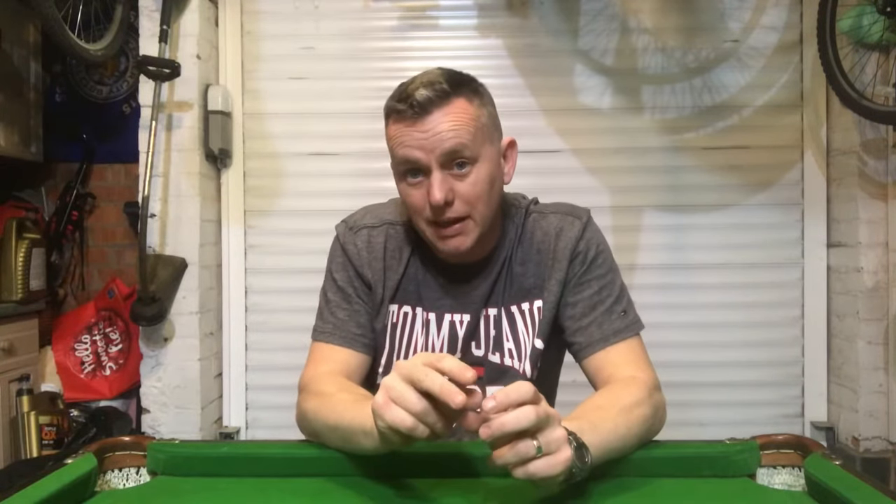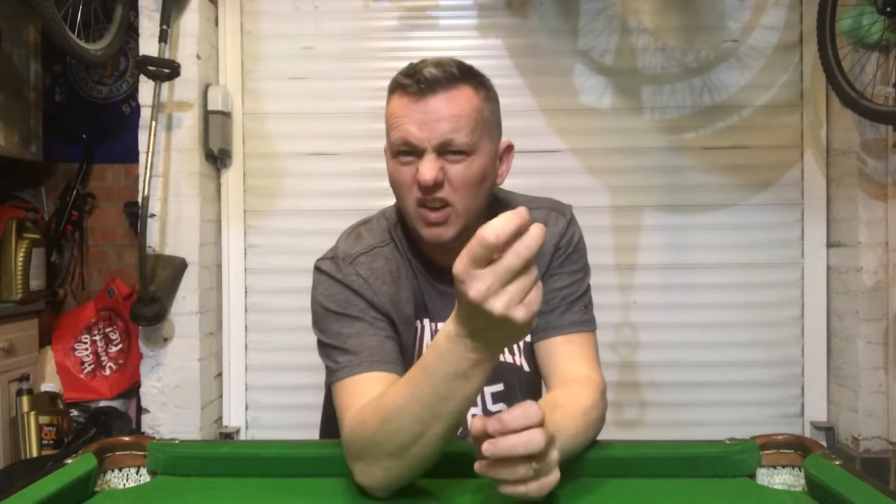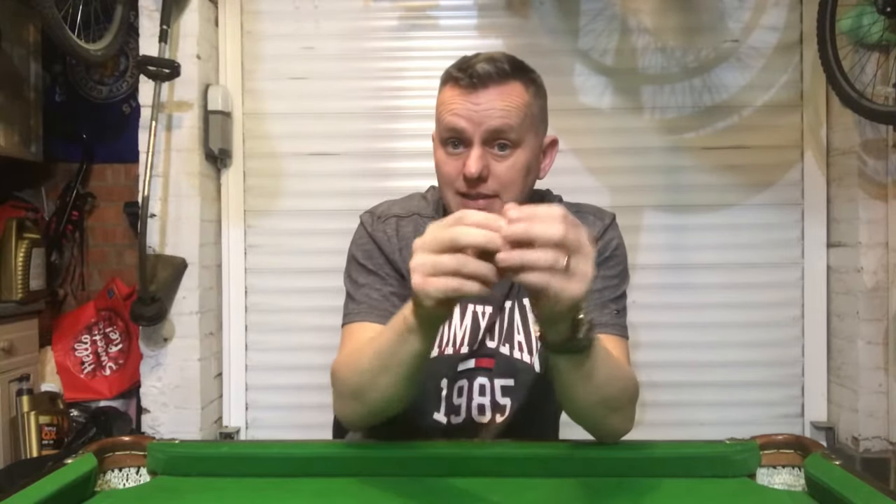Now how does a bulb work? This is the simple stuff - you've really just got to go back to basics. Although the bulb is lit and working, it's got a black tinge to it. The only way a bulb can get a black tinge is if something inside has gone wrong. These bulbs when they're made have the air sucked out of them - they have a vacuum and are then filled with an argon-nitrogen mix, with a little tungsten filament inside. When these bulbs wear, because of the gases inside, the element evaporates and sticks to the glass. So if you see black on a bulb, you know that bulb has almost had it, or there's arcing of some sort causing evaporation of the element.